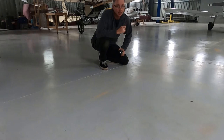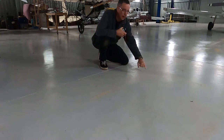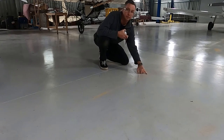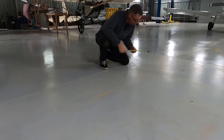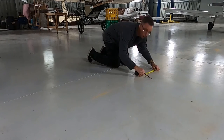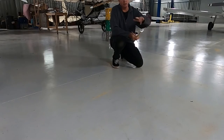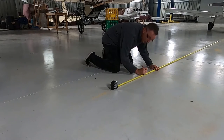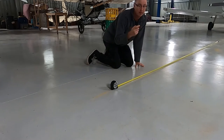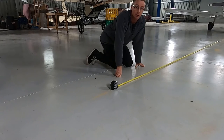Now what's left to do is take a couple of measurements: from the tail wheel point to the datum, and from the main wheels to the datum — the datum obviously being the leading edge. The main wheel to datum is 158mm. From the tail wheel to the datum is 3905mm. From those measurements we can do all the calculations we need to finish off the balance of this aircraft.